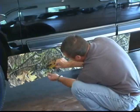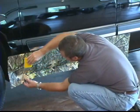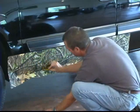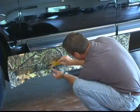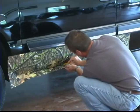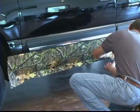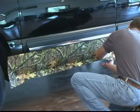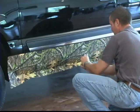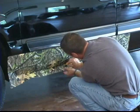There we are at the bottom of the door right here. Once you get it down to the bottom of the door, you can trim that door out with your razor knife, your utility knife. Make sure you pull that material loose from down there on the rocker panel, making sure that it's all the way to the bottom of the door before you trim it out. By pulling that material loose and pushing it down in there with that tool, we'll make sure we get it stuck all the way to the bottom of the doorway.